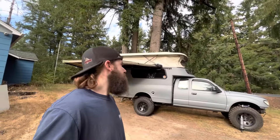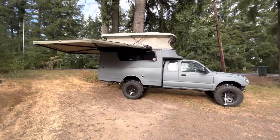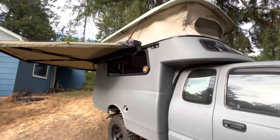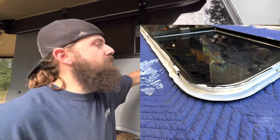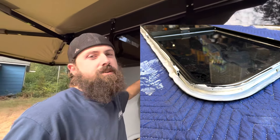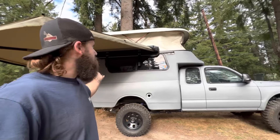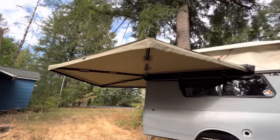What I have behind me I can only describe as everything I kind of envisioned it being, and I'm quite happy about that. I have it out in full display mode plus some goodies we'll talk about in a second. Since the last video I put in the windows — I'll throw in some pictures of what that looked like. This is pretty self-explanatory: basically just the reverse of taking your windows out. Make sure you put your spacers in and slap them in. I still have to trim all the butyl off of it, but I plan on still putting siding in, so I don't want to trim it yet since putting the siding in will make it squeeze tighter. Here's our awning out — that's a Delta Wing 270. It is free-standing but there are some legs if you ever need to drop it down.